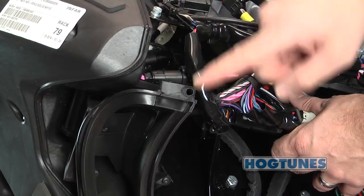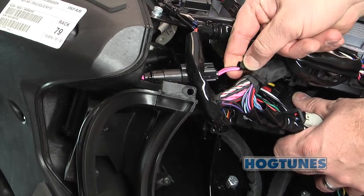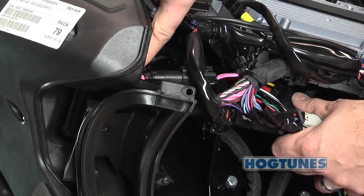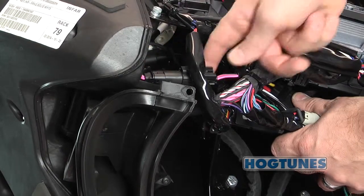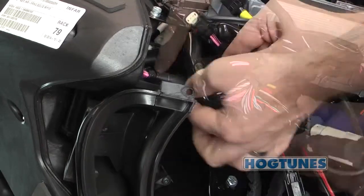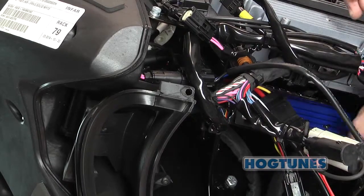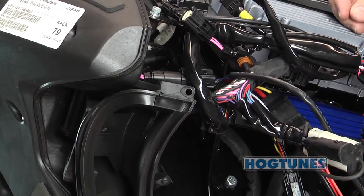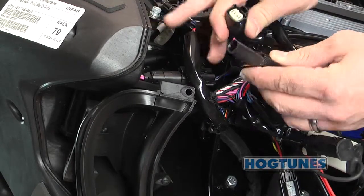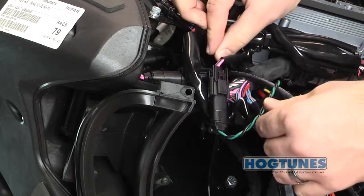On the brake side of the bike, right above the air inlet, you will see a two-pin connector with pink and pink with black striped wires going through it. The plug is close to where the wires enter the brake side speaker cabinet. Separate the connector so you now have two plugs. From the amp, take the plug with blue-black wires and plug it into the mating plug you just separated, noting it will only go in one way. Also from the amp, take the plug with green and black wires and plug it into the mating plug you just separated, noting it will only go in one way.